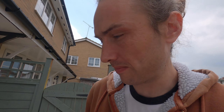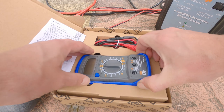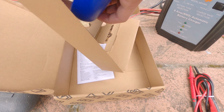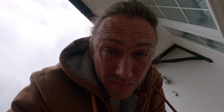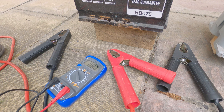Let's get this all disconnected, switched off, and get this multimeter out of the box and see if it says what I want it to say. So we're going to test the good battery first and see what reading we get. Okay, so we got like 12-point-something volts - which is good, that's what it should be saying. Let's see what this one, the Optima battery, says.